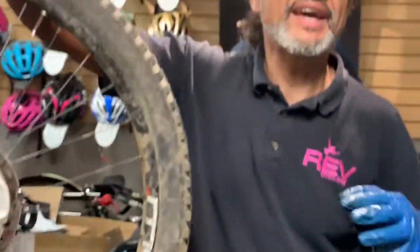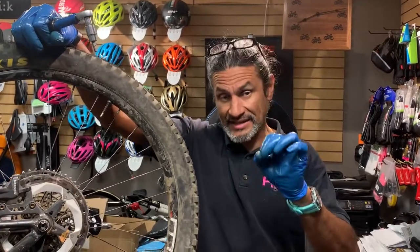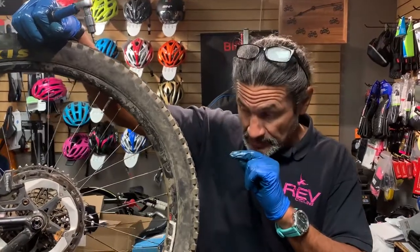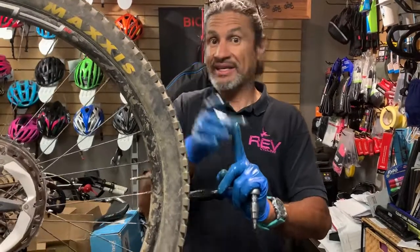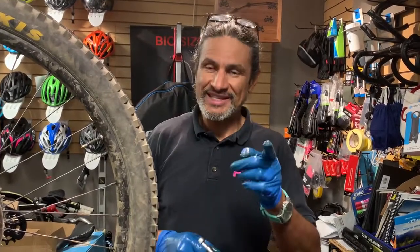That chainring has been replaced, and that's how you replace a direct mount chainring on an XT crankset. I should mention that lock ring is only for XT and SLX — the XT uses a specific lock ring. The big thing with this is you need the proper tool, because with that crank spindle it's nearly impossible to use any other tools for it. Thank you so much for watching. I appreciate all of you who have subscribed — if you haven't, please consider subscribing, and please like and share. In the meantime, we'll see you up the road.